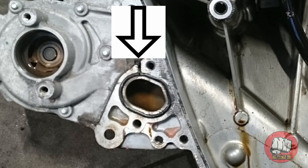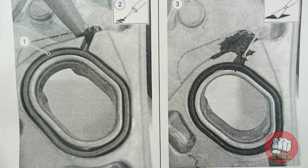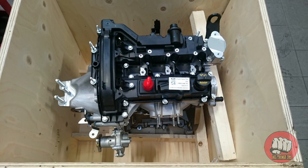Here's what the first solution Ford came up with, which was to remove all this and put a nice healthy dollop of silicone in there and a new gasket — which yeah, it does do the job to an extent but it's not great. Should your engine overheat, unfortunately quite often it scraps the engine and then you have to change the whole engine.